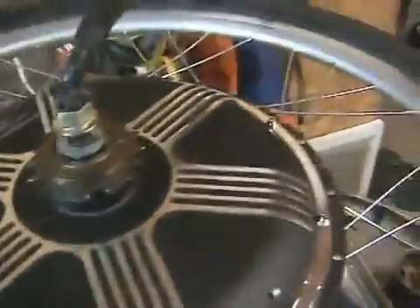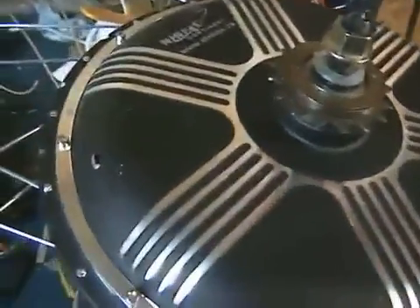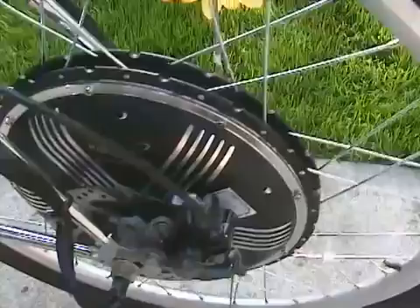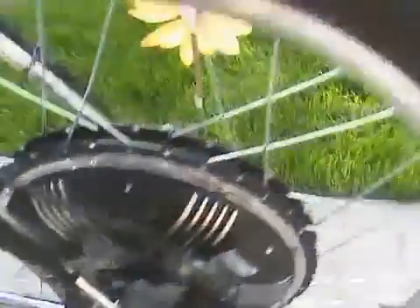They're really close to the stator. How I did it is, when I lifted it up high enough, I stuck this under where I was going to drill — it catches all the shavings. Then I just spin the top on top of this and drill. This saved me from slipping and ruining my stator and my windings. So it's done — it's not burnt. It can definitely handle over 40 amps. Piping hot. Sweet. Well, those little simple holes worked — it isn't even warm to the touch after I gave it on.